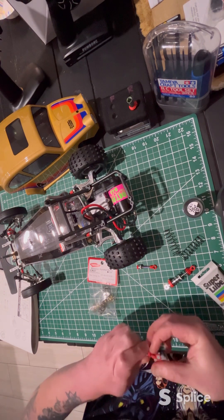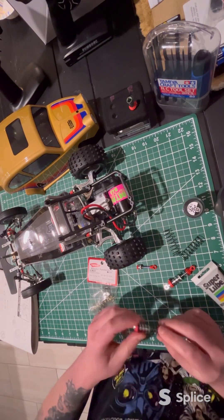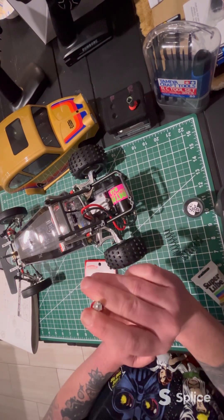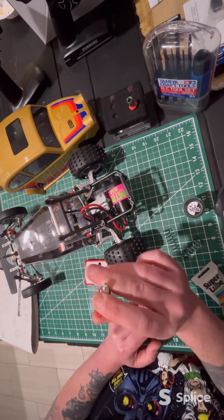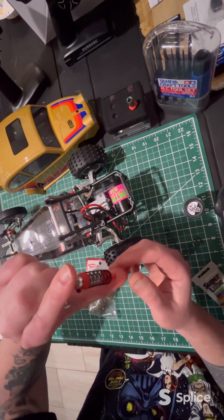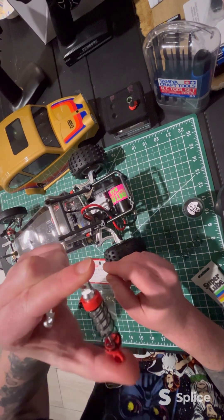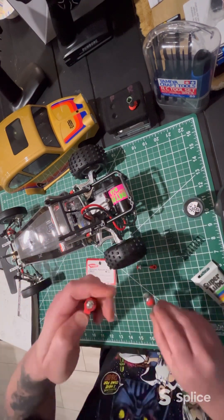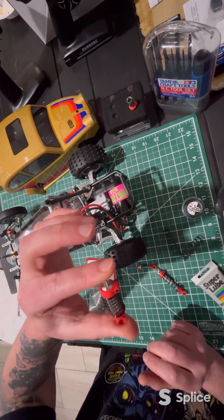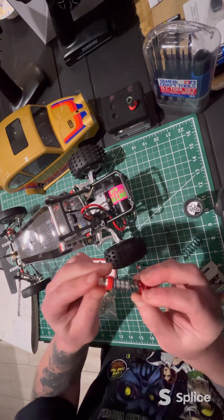If you find that 70 is too thick, you can mix and blend it down or up as you prefer, but I just went with a straight 70. This is the rear shock — I already have this one rebuilt and put together. Super stiff. This is probably at least 40, maybe even 50% thicker and stiffer than before. I actually have to put some pressure to fully compress it — nice and quiet, glides well — as opposed to this one where it takes little to no effort and you can hear it squashing around. I mainly just had the rears leaking, not a whole lot in the front.